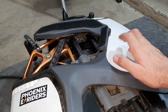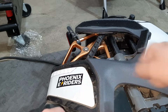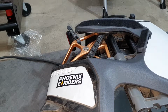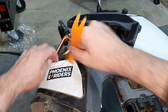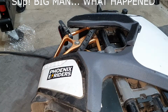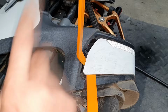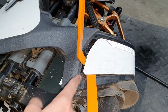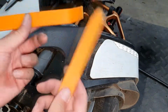The 4th step is to take out these panels. So this panel at the back does not have any screws. It just needs to be popped out from the corners with some plastic tool or a screwdriver. A screwdriver is harsh and might damage it, but if you have something really soft, you can use it to just pop it out. For these, if you're struggling on one side, immediately try the other side, because sometimes these locks can be tricky. So if one side is too tight, come to the other side and you'll be able to do it. Just like that, with plastic tools.